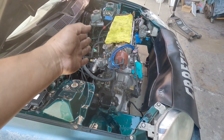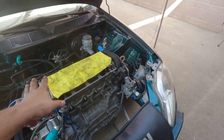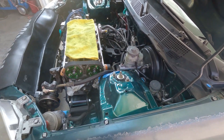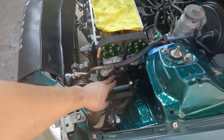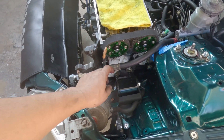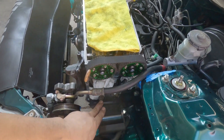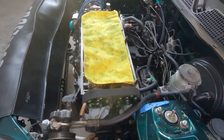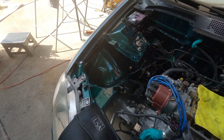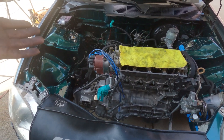As you can see, it sits correctly — somewhat. It could use a little bit of leaning backwards, but it's okay, because I need space for my intake manifold. The engine mounts — these are B-series EK swap mounts, which are the inexpensive ones. The stiffness of the bushing, I have no idea. But I bought a replacement just in case — one of those 1320 bushings, 75A. I just want to try it out first and see. It's for review, so you'll be updated on whether to get that one or not.